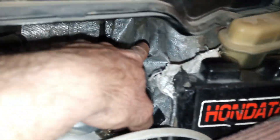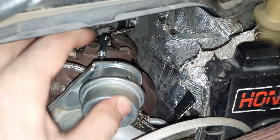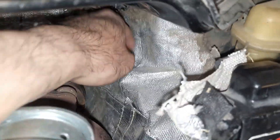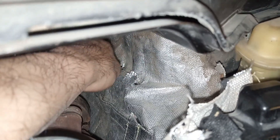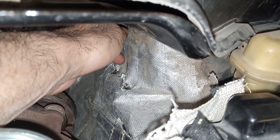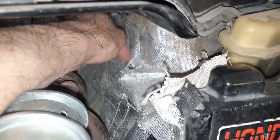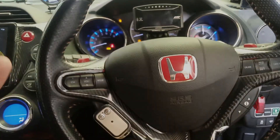The way I have adjusted it: I shortened the wastegate rod so it is very tight now. This was a 6 psi spring but now it is nearly 9 to 10 psi, so I don't need the low boost setting — I've set it to minimal. I have tightened the high boost setting to my desired level, which is 15 to 16 psi — one bar. I'll be experimenting with that. The lower boost is all controlled by this. Hope you like the video, subscribe and share.